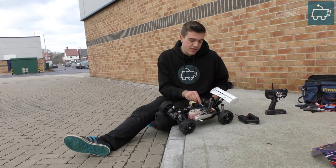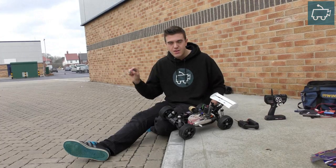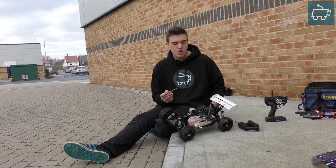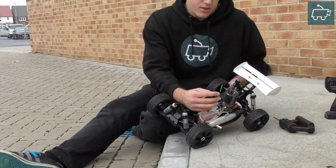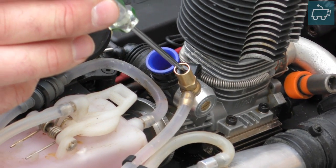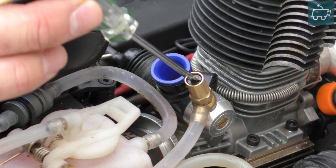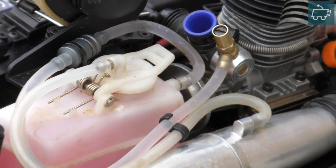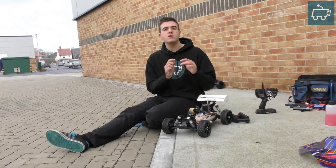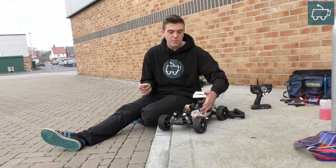It's as simple as that — there are only three things you need to worry about. One last tip before moving on to the next video: when adjusting, it's essential that you only do very small turns at a time, just one eighth of a turn clockwise. One eighth of a turn is just that much — going from there to there. If you go making very large adjustments because you're getting impatient, you're going to miss the optimum setting and go from too rich to too lean or vice versa. So it's essential that you make small adjustments at a time.